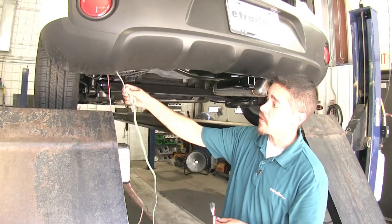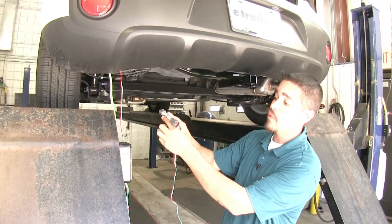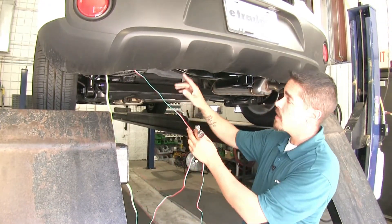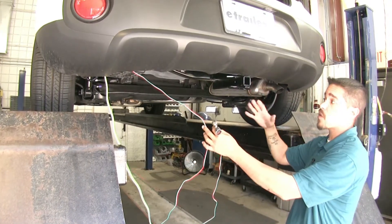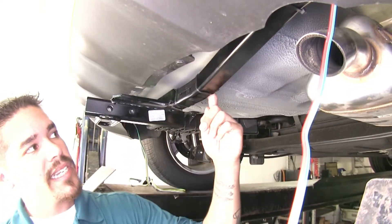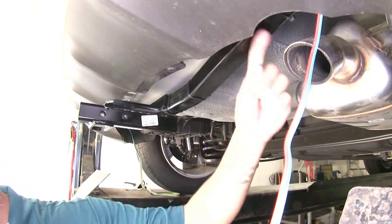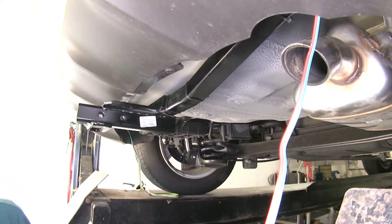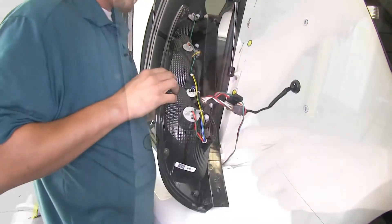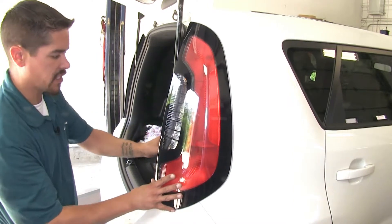At the bottom of our bumper we're going to have our four-pole wire and a red and green wire. We're going to need to route our red and green wire with the T-connector over to the passenger side. Everybody's going to do this a little bit differently, but you want to stay away from heat sources or any moving parts. I just ran my wire on the backside of my hitch, zip tying it along the way, and then used the same fish wire technique going down from up top and attaching the wire to pull it through. Now we can line up our passenger tail light and put the hardware back in place as well.